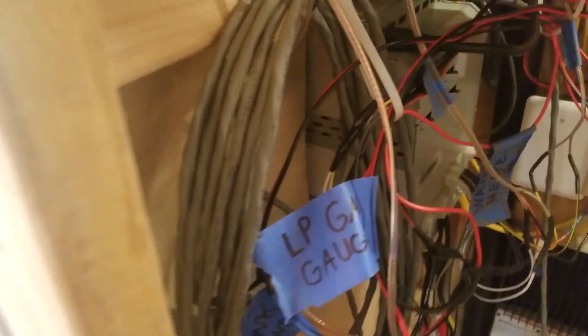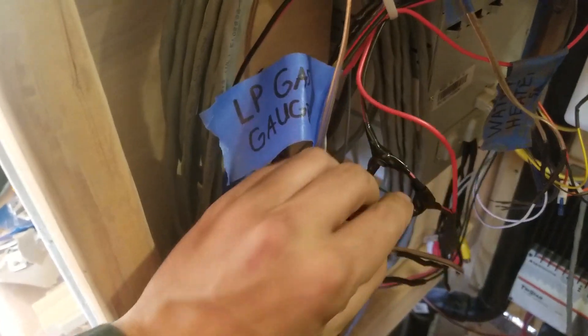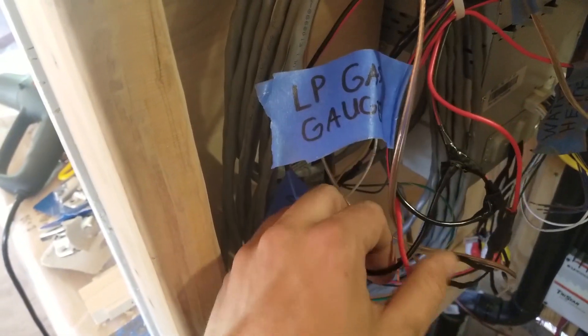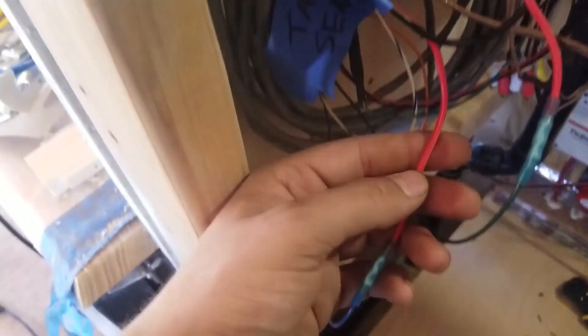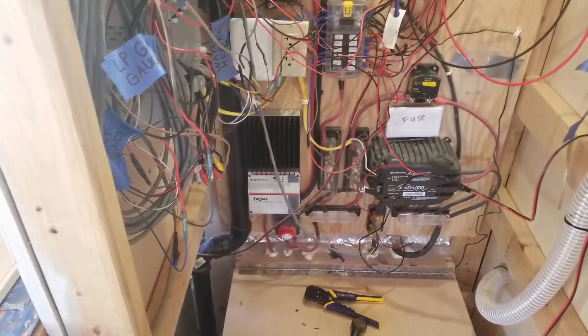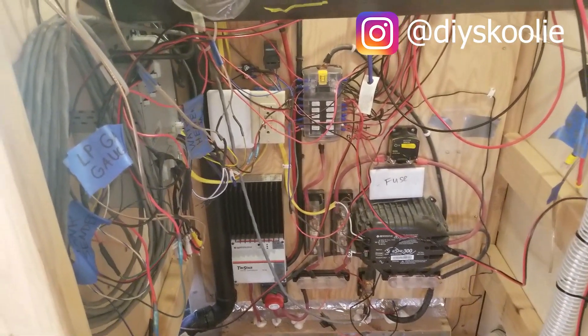Let's take a look at the wiring — I know it's kind of a spaghetti. Here's the LP gas. One wire connects to the common ground tank sender, and also one black wire connecting to the common ground. On the LP gas the red comes down and connects to the green wire, and on the tank senders the red comes down and connects to the blue wire. All the senders are attached to the same wire. It's a little bit of a mess — I've just been adding to it as I go.